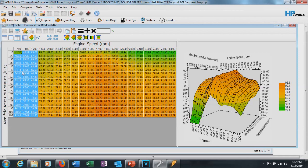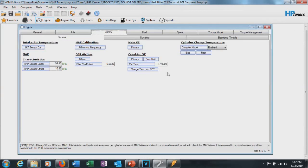Once you get the car started, the first thing you're going to tune is the VE table right here. Once you get that good and get the fueling right, then you're going to move on to the other tables. For now, that's what we're going to worry about. Leave the MAF alone — you should be in speed density. Try to avoid using the MAF because it's just so inaccurate at idle. Also, if you have the trims on, large cam overlap is going to create false lean conditions and lots of issues, making it very hard to tune. So again: speed density setup, tune it in, tune the VE.